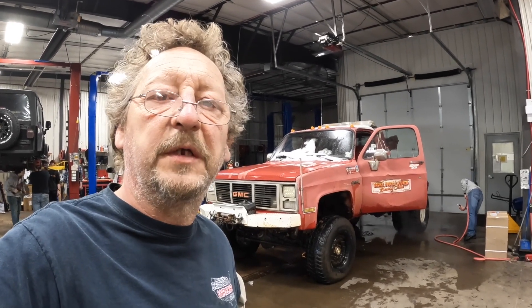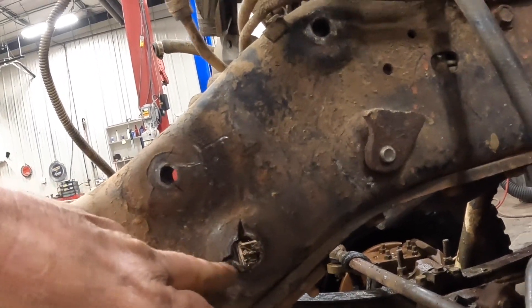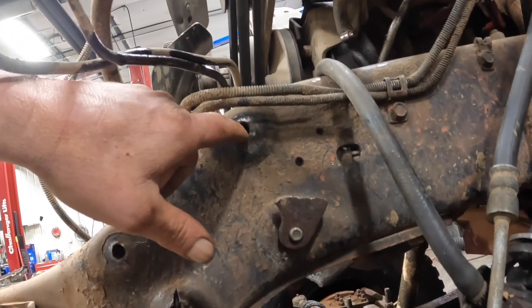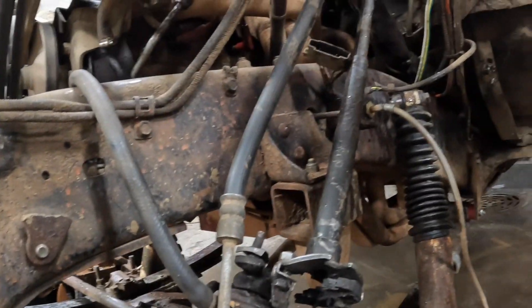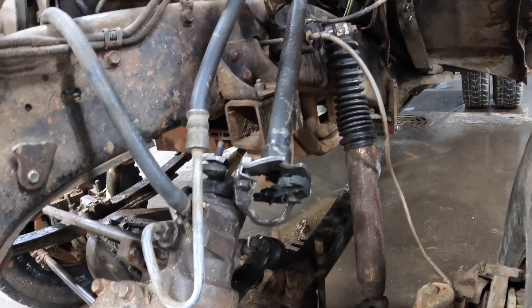It's time to take the wrecker to work and fix up the steering. The shop is still a far cry from being done, so we're going to take the wrecker to the dealership. First thing we need to do is take the bumper and the front clip off. Taking a closer look at the damage — that's the bolt hole that pulled right through, some cracks on this one too, and that's where the ear broke off. We also tore up our rag joint, which is why we couldn't steer and had to use the winch.